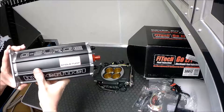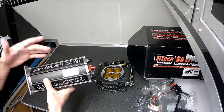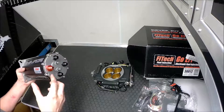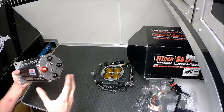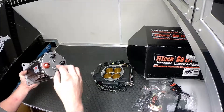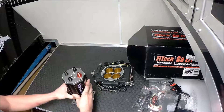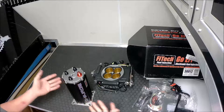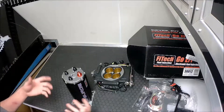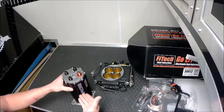As I said, this is the single pump system. The case itself is the same size as the dual pump system. The way to tell, aside from a sticker that says single or dual, is the red fitting — that's the pressure side coming from the internal pump. The single has four fittings total, the dual pump has five total, and you'll have an extra positive wire terminal. I already opened this one up and looked at the assembly, and everything's top notch inside. On a future video I'll open it up for y'all. I think the volume was a quart.